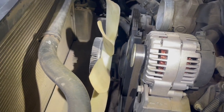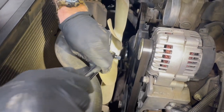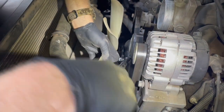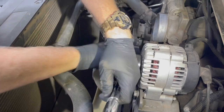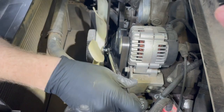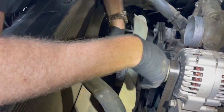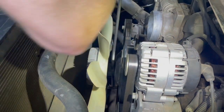So on this particular spanner wrench tool, use a break-over bar with it. What I like to do is put these two wrenches together and work against them. I believe this one is regular thread, not reverse thread, so it should just be lefty loosey. Oh yeah, we got it broke loose — just that easy. We're going to spin the fan off. It's a little stuck on there — it's usually a little easier to spin off.